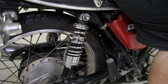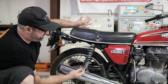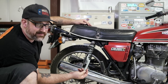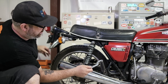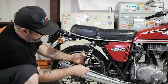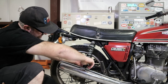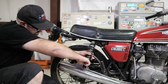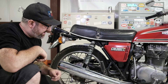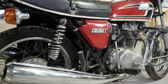So let's put the bike on the center stand, take the spring up a notch, and try it again. I'm going to tighten the spring up one notch. A lot of you guys have this tool — it's a shock adjustment tool that usually comes with the shock absorbers. I'm going to be turning this lower adjuster here one click. You'll see it as I rotate it, and on this one it needs to go this direction with the wrench in there. Click — one notch. We'll do that on the other side, then hop on the bike and do the same thing again to see where the dot ends up.